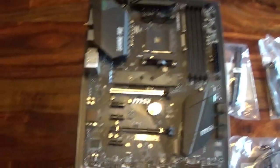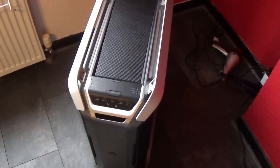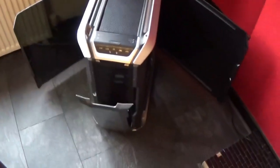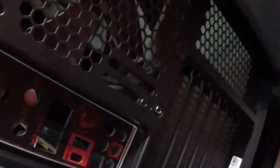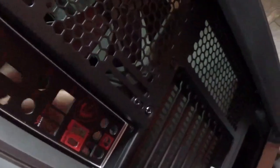So that's the motherboard out of the packaging — much prettier than most other motherboards I've ever had. I'm going to hook in the panel. Look at this thing — it's like some sort of transformer. That's us got the connector panel on. A little bit of advice when you're pushing this on: try to avoid pushing in the middle because you'll end up bending the metal — it's quite fragile. If you poke it in at each of the four corners, it should just click into place, no problem.